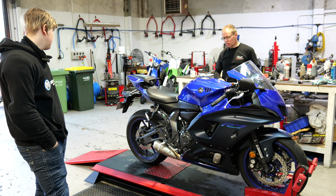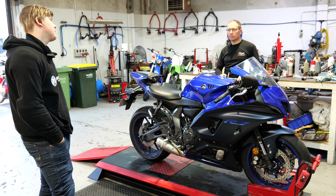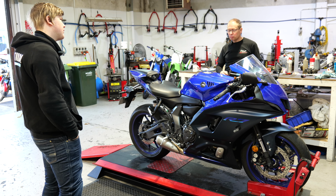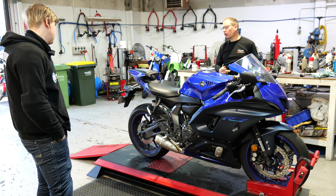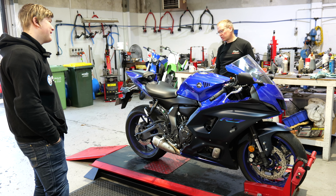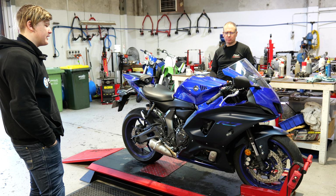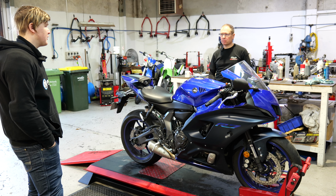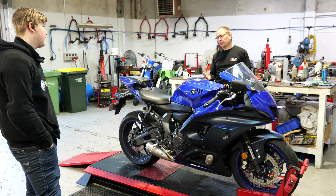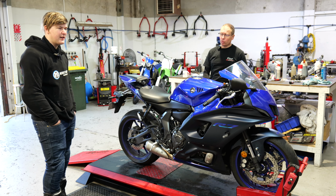What tyre pressures do you run? I've been experimenting with them at the moment. I'm currently on, I think it was 33, 34 or 32, 34. Perfect. A lot of manufacturers will say 36, 42 or 36, 39. Too hard for our roads. That's what my mate put it as when I got it off, and I was just like, this feels way off. I was sliding. Because your tyre is part of your suspension as well. If you're on a bumpy road, and our roads are bumpy here. Definitely are. All the fun ones are anyway.